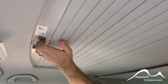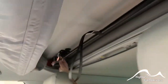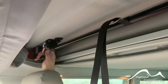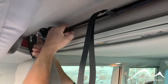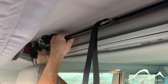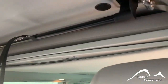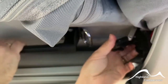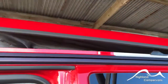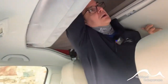This is the manual roof on the California Coast. Pull back on the plastic sections and you'll see two pairs of clips on each side. There's a safety clip which needs to be undone first, then let the seat bolt mechanism drop, and then you have a metal bar which you pull down on. Push the clip upwards, pull the metal bar back towards you to release one side, then take the safety off the other side, push in on the button, and make sure the clip is clear before you push up on the roof. Use the main crossbar to do that and the roof should extend up - you can then follow that with the bed mechanism as well.